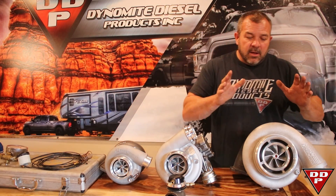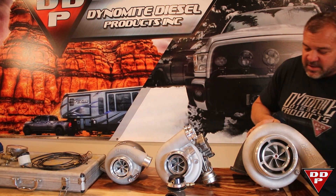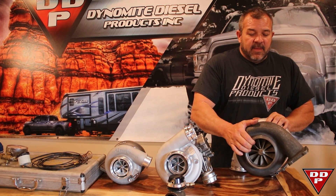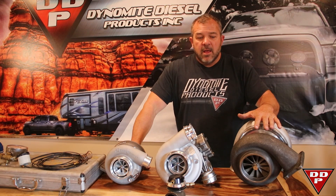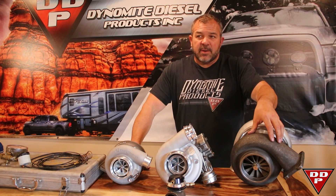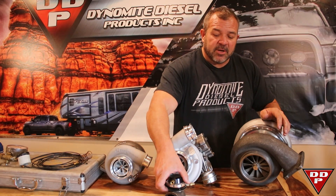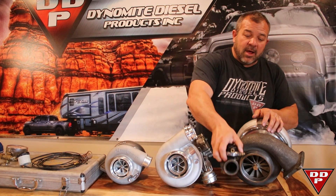If you're going to do something like compound turbo with a great big turbocharger — this is a Precision 88 millimeter compressor wheel with a G-trim turbine wheel, so the turbine wheel is massive. The balance here is actually the opposite of what people usually do. We had this built because we were going to blow a couple of 98s into this and use a triple turbo kit. We've got a huge turbine wheel because this is our manifold turbocharger; all those pounds per minute are going to come in and make only a couple pounds of drive pressure. With a big turbine wheel and big turbine housing you're relieving a bunch of that pressure, but we'll still require a couple of 45 mil gates or similar — it takes a lot of gate to do that.